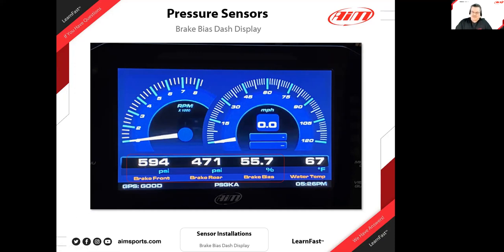To me, aside from health sensors, brake pressure sensors are probably the most important sensors you can put in a car — way too much useful information. This front brake pressure percentage is a math channel stored on the logger in real time. As sprint racers, we know that on this tire and track, 56% brake bias has felt the best. Sitting in the paddock before going out, we can just push the pedal a couple of times with new pads on and get our brake bias pretty close right before we head out.